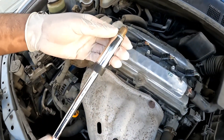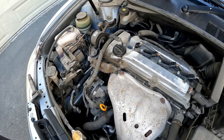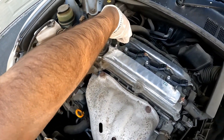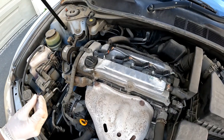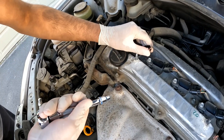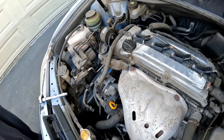That's how you remove a spark plug — I'm going to put this one back in now. Torque it to 25 Newton-meters; make sure it's within specification, otherwise your engine may run quite poorly. Now I'm going to put the ignition coil back in, make sure it seats properly, sit it back in, and plug the ignition coil back in. With 252,000 kilometers on it, this ignition system has gone quite crispy. Let's start the vehicle up.